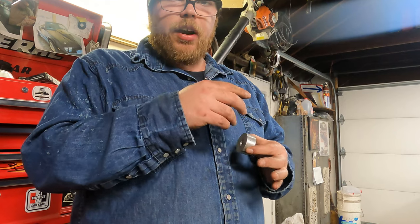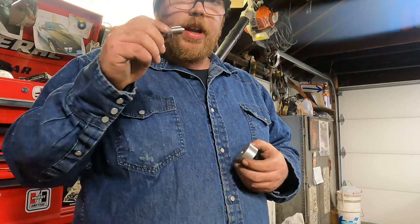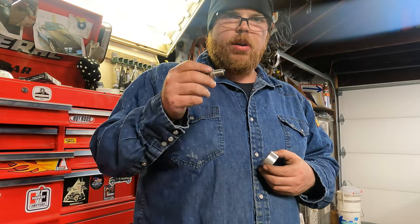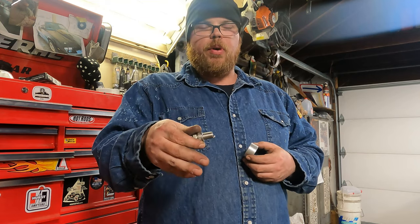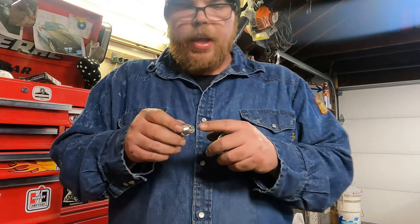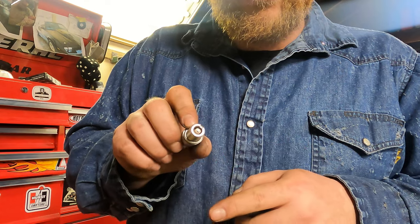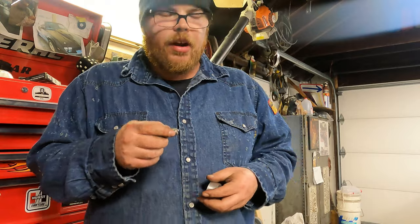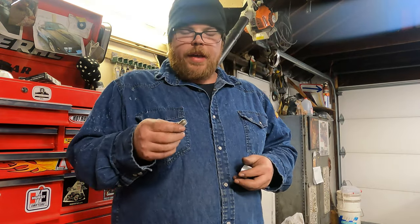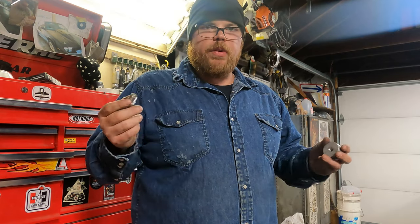And with the cylinder head off of the motor, you can thread these into each cylinder head hole until you find the right one that points in the area of your desire, whether you want it at the intake valve, exhaust valve, or pointed down at the piston. And when I say point, I mean the electrode strap there. You want it to point wherever, whether you want it at the intake, exhaust, or straight down at the piston. So with the cylinder head off the engine, you can thread them inside each hole until you find which one it works in.